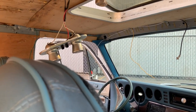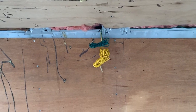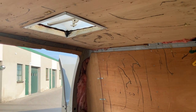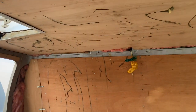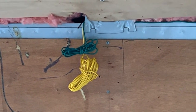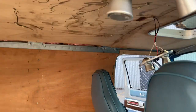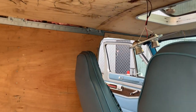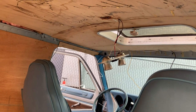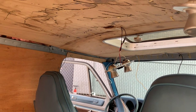Now that it's empty I'm taking a chance to run a few wires. I'm not going to put much because I'm not thinking of dual batteries, so I don't want to put too much stress on the front battery — the green one. I'm hoping to put maybe a maxi vent, something with an intake/outtake fan. The power is sitting there ready, running to the battery. The yellow wire is going to go up to the console — eventually a toggle switch for some kind of light. The ceiling lights are tied to the dome switch on the headlights, and I don't like turning that on because even when you turn these lights off it seems to drain the battery.